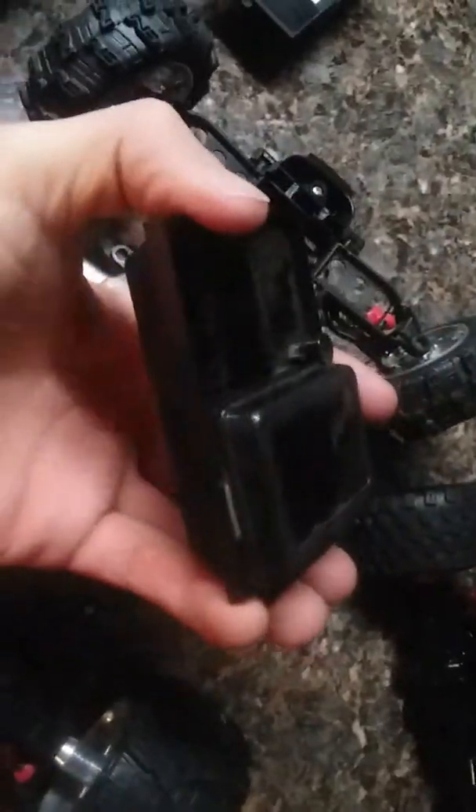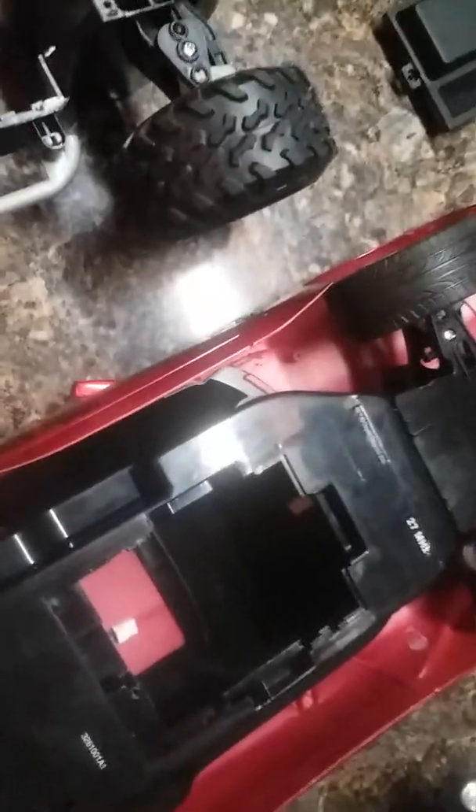Even the Baja - if you wanted to, take this circuit board back out, take this lithium RC charger, put it all back together, pop it in there - recharge on the go with the USB port. Now granted, this only has a two-cell in it, two 3.2V cells that charge up to 3.7V max if it hasn't been run down repeatedly.